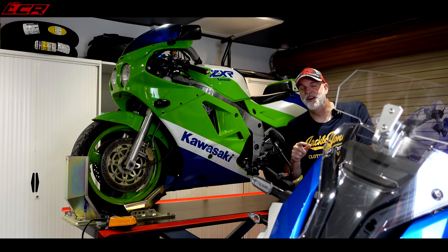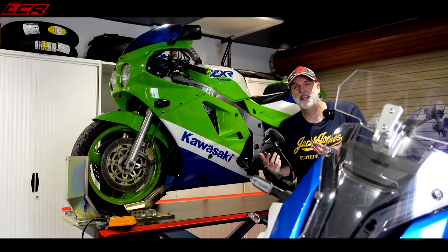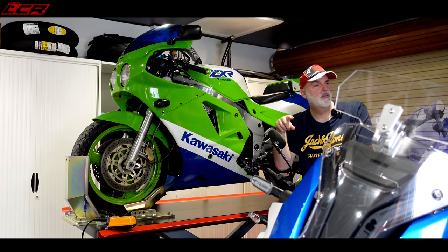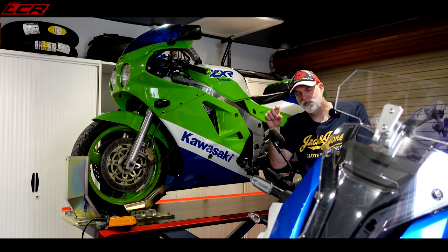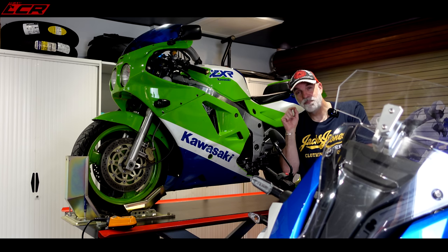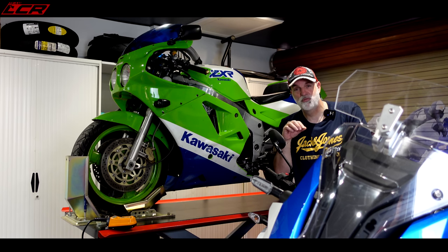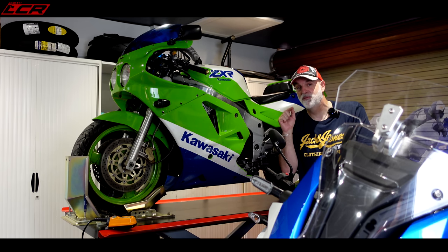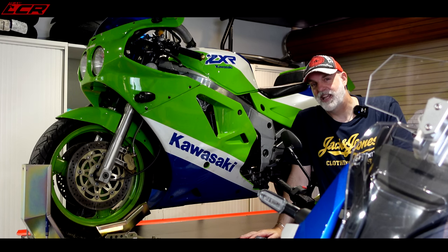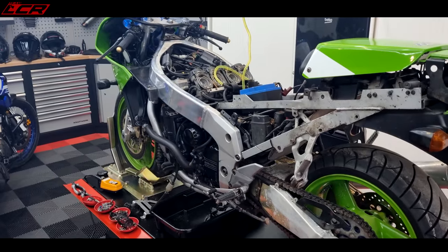So that isn't it - I've actually had a bit more of a play around with the bike to see if I could stop all that fuel pissing out the carb. Basically the float - the float was actually jammed up and that's why the fuel was pissing out of it. So I took the carbs off again, I had a pilot jet blocked on number two so that's why number two was not firing. I cleared that out, took the float out, reset the float, and I tried to start it again.